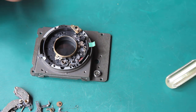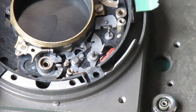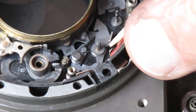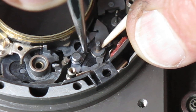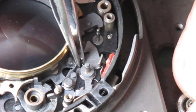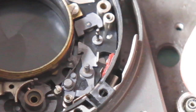This spring is worse — I'll zoom you in a bit. This is very keen to get away. I always hold a toothpick or something over the center so it can't get away. Pick up the end, unhook it. I've released the tension from it now, so it's been defused. I can lift it away and put that somewhere very carefully.